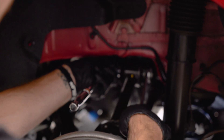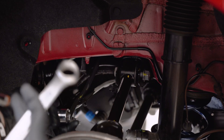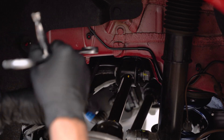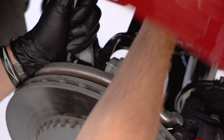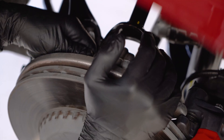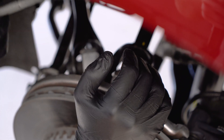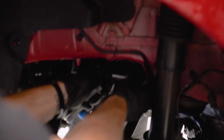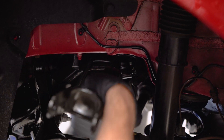We are going to be cracking this nut and bolt loose first. Okay, that should have removed all the pressure and now I can proceed to the hub here. You want to be sure that you press inward on the top of the rear rotor to relieve pressure from the outer bolt and remove it from the hub assembly, then slide the bolt right out. Remove the other nut and bolt on the subframe side by hand and then this guy should slide right out.